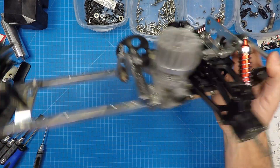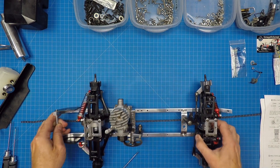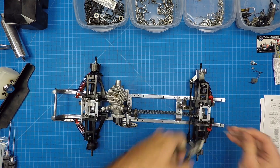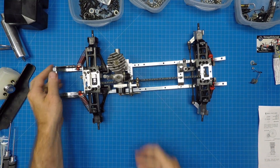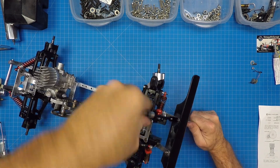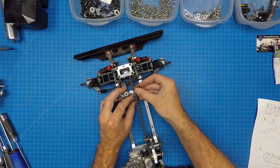The chain needed to be taken apart at the length that slides out. Once installed, make sure that everything moves freely. The key to good travel is to set the chain tensioner correctly. One of the bigger parts of the buggy is the front bumper. This part seems to get abused when you run it — of the three complete Vannings, I only had one with an original bumper. It attaches easily to the front with two screws.